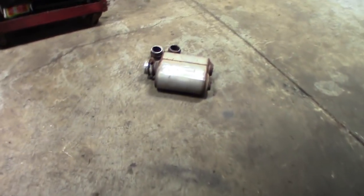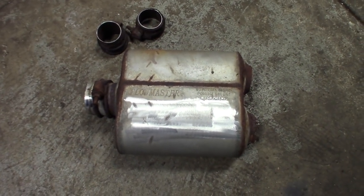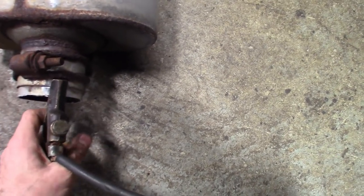I got this little area cleaned off on here. I'll show you guys how I get prepped up, how I set the MIG welder, testing the metal and seeing where my temperature needs to be and the wire speed and all that stuff. All right, guys, so real quick, before we get you set up on the tripod, I just wanna show you how I get this prepped. Got it plugged in. You always want to make sure your grounding points are clean. Get the clip down there. Ground's important, very important. I got the surface clean. The cleaner the surface, the cleaner the weld's gonna be.